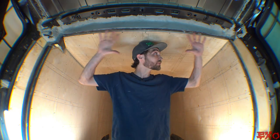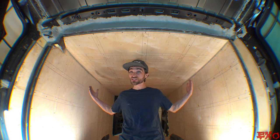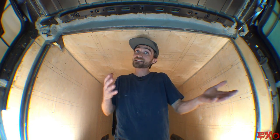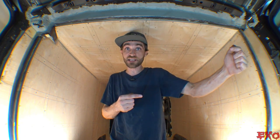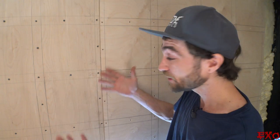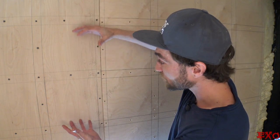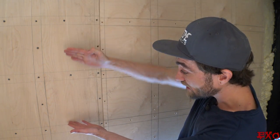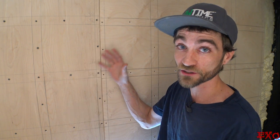Number four, since the front chamber's port would have to be so massive and open, having the two rear ports firing from the side into that lengthy opening without much of a boundary does raise questions for possible loading issues. The quarter wavelength to the next nearest boundary, the windshield, could end up giving me grief. Number five, there's really not enough port area for proper testing. Usually you would start big and shrink to find your sweet spot, but with this design, the port would already be at the small end of the range, so that means giving up the chance to test larger ports altogether.